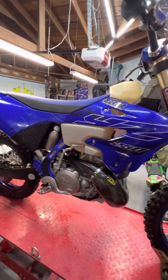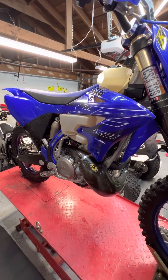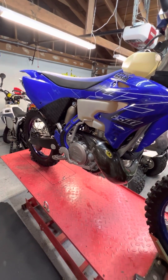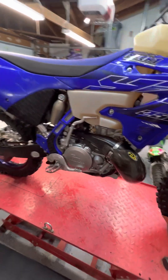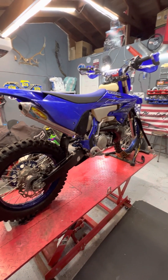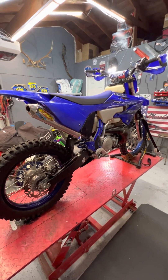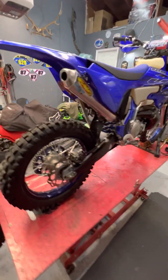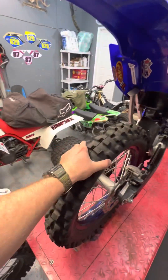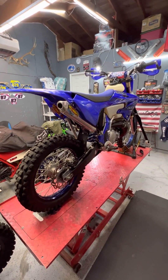I wouldn't say it's better than a 300 — I went riding with some 300 guys and those bikes are just tractors, they're awesome — but the 250 held its own. The e-start would be great though, definitely. Not running any clutch upgrades at all, stock, no Recluse — actually clutching it. Running Yamalube 20w50 and I beat the crap out of the clutch on a six-hour ride in very silty, dry, hilly conditions and it did well. The Shinko is holding up really good too — about 10 hours on it through rocks and everything, got about one more ride on her. This is my 2022 YZ250 trail bike review — thanks for watching.